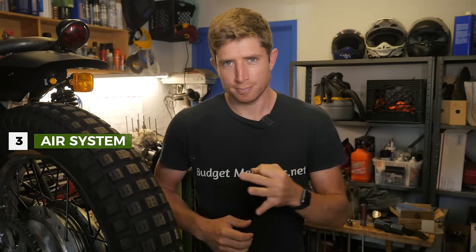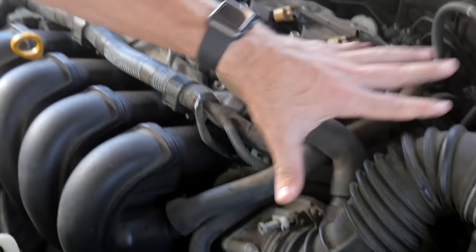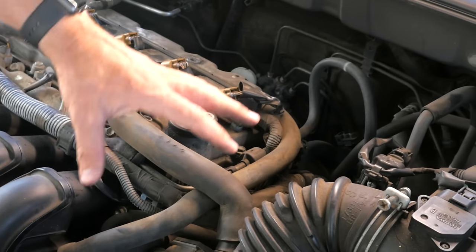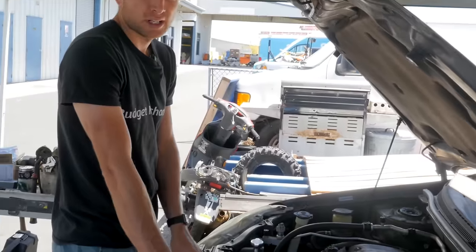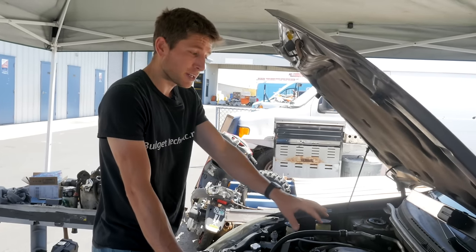Third thing: your air system. Your air system brings air in and mixes it with the fuel at the right ratio so that your engine runs smoothly and efficiently. If the system starts leaking or gets dirty or contaminated, it can cause your car to start running rough. A vacuum leak would cause rough running because air is entering where the system is not expecting it, throwing off your fuel mixture. Leaks are usually through rubber hoses that can be physically seen, or sometimes if they're really bad, you can hear a hissing noise while the engine's running.